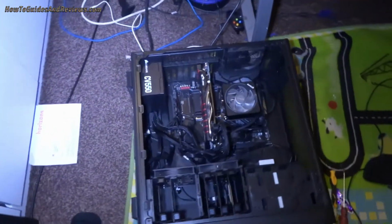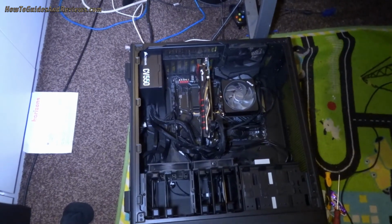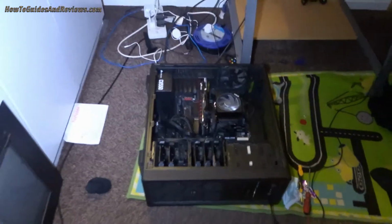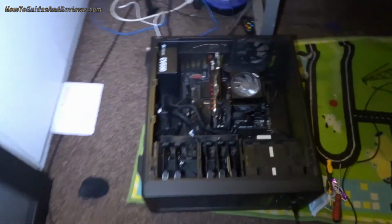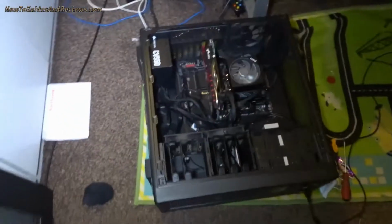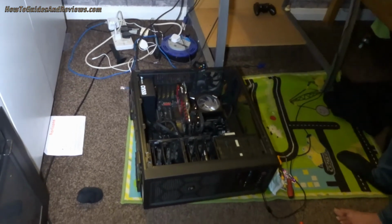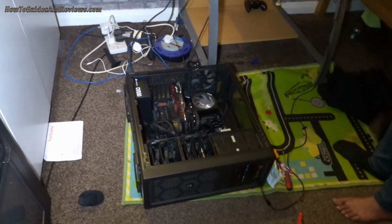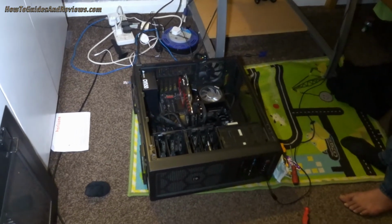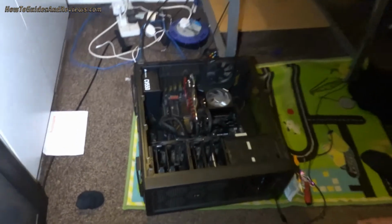So there you have it. MP600 has failed after 9 months. It was doing exactly the same. After the initial issues, it failed within a few minutes. You couldn't read from it, and then it wouldn't let the system go past the boot screen. So I took it out and the system booted fine, because it was a D drive, second drive, not system. And it's repeating it in this one. It won't go past the BIOS screen.